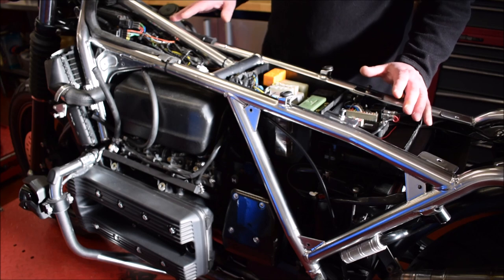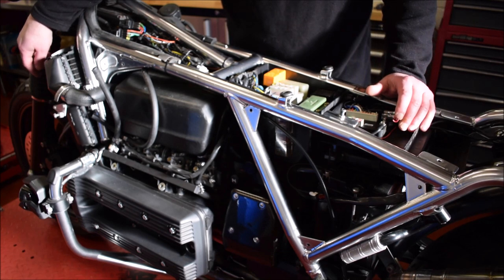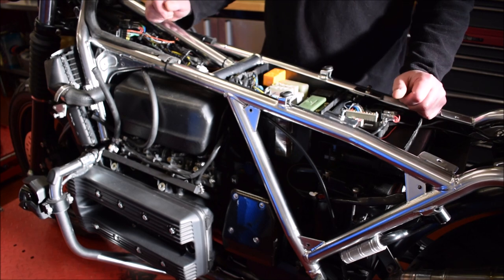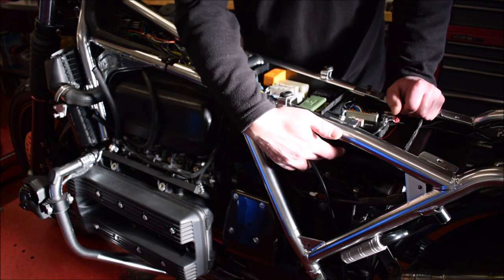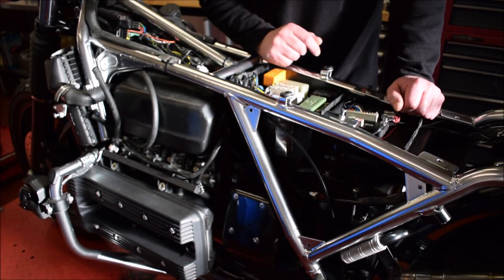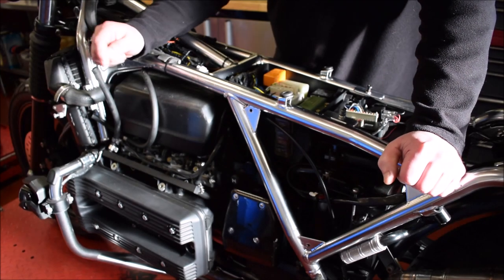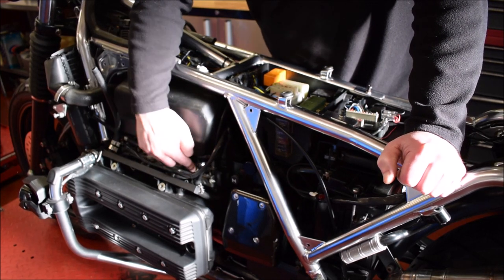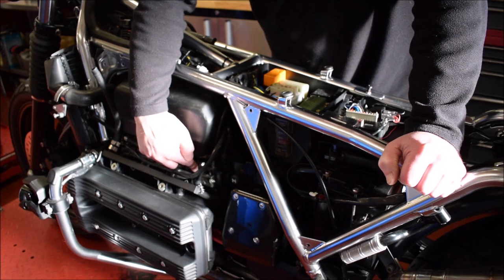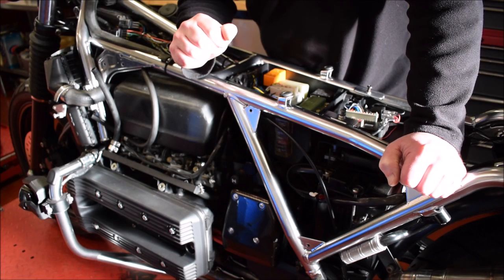So now we're going to remove all the stuff we don't need from the fuel injection system. So that's going to be the hall sensor, the cover, all the hall sensor parts. The only thing we'll keep is the brass timing disc, we'll use that later. We'll remove the ignition control unit, the brain. Disconnect the battery in a minute before we start, of course, and then we're going to remove the coil pack, this cover, the leads, and then we're going to remove the plenum chamber, the air box with the airflow meter inside. Then, because it's the 8 valve, we'll be removing the 8 valve throttle bodies, we're not going to be using those. I think that's about it, and then we'll look at the next stage.